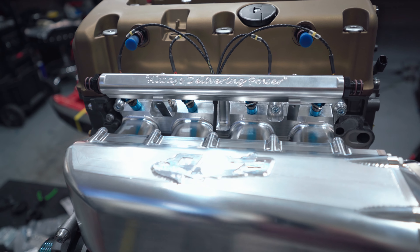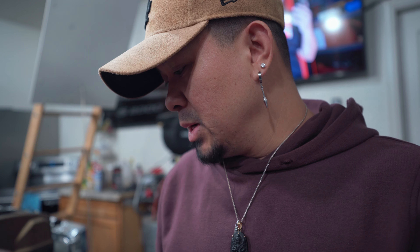There's our bracket right there — the nut part goes up and the bracket sits like that. I was going to put the engine harness on the motor, but I realized we need to install the transmission before we do that. So what I'm going to do now is put it back on the PLM engine stand so that tomorrow when the radiator comes in I can install the radiator, do the clutch, and then we'll be ready to throw the motor in the car.